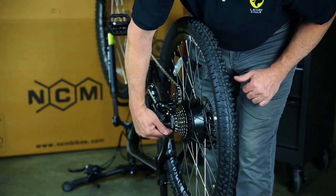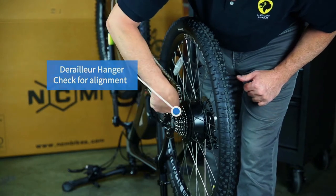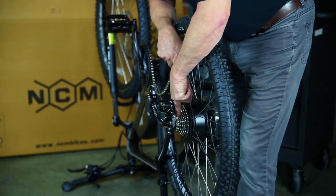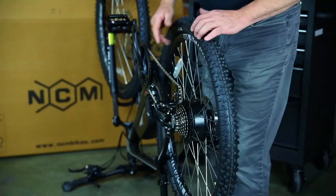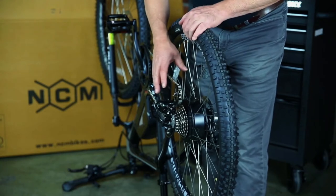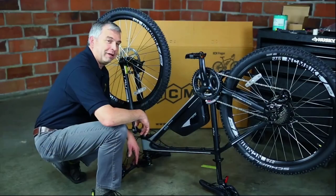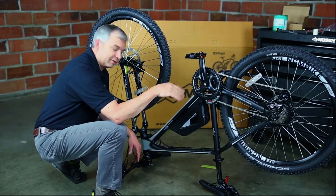The critical observation is the derailleur hanger and the rear cage of the derailleur — especially this pulley wheel. This pulley wheel should be right in line with the smallest cog. That's how it's adjusted when it's shipped to you. If it's damaged during shipping, you may need to adjust it a little bit. If you're not comfortable doing that, this may be a point where you take the bike to your local bike shop for assistance.